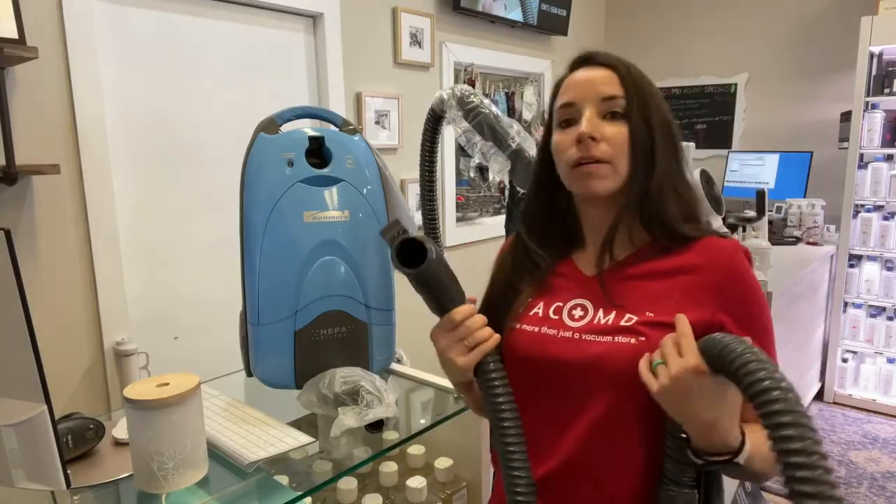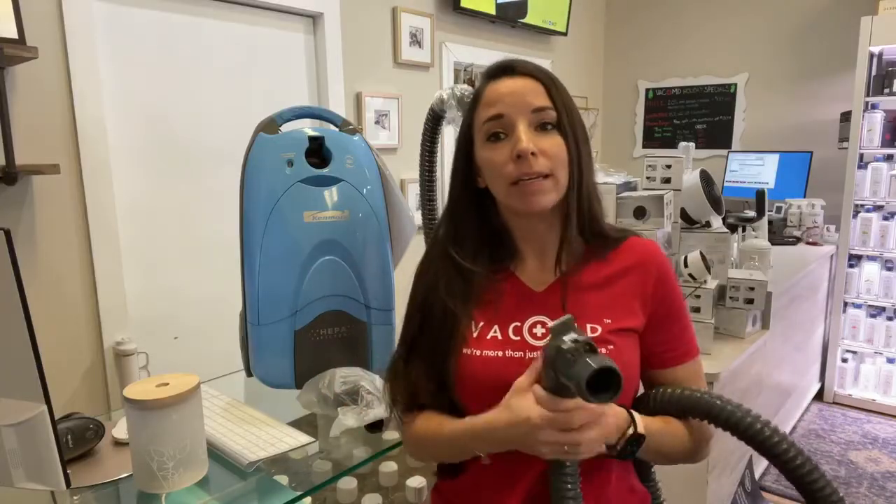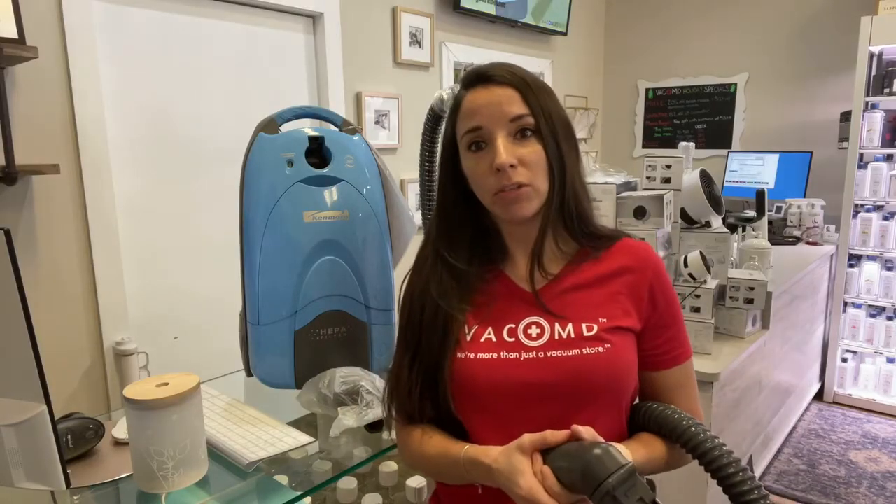So that would tell you if your vacuum is clogged. If it's still not sucking, check your bag and check your filters. And if it's still not sucking, bring it in — it probably has issues that are greater than what I can help you troubleshoot right now.